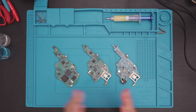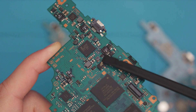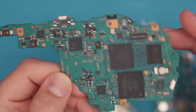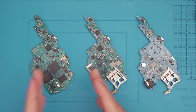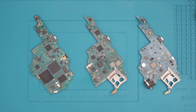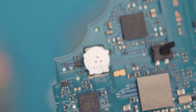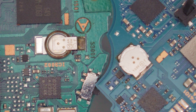Once you have your PSP motherboard disassembled, there is one thing you want to take care of — your UMD sensors on these various motherboards. Just be careful that it doesn't snag on anything. It's very fragile and it's present on all three models. The 1000 and 2000 models share the exact same supercapacitor. As for the 3000 model, that's what it looks like, and here's what it looks like side by side with the other two.